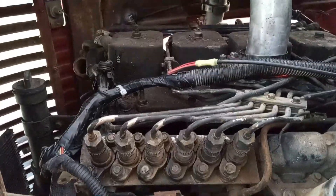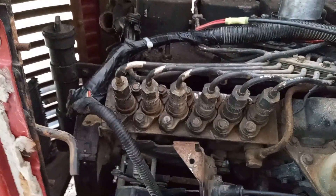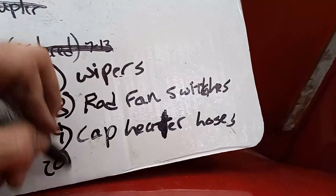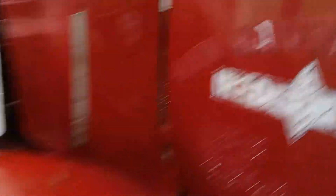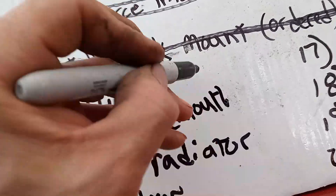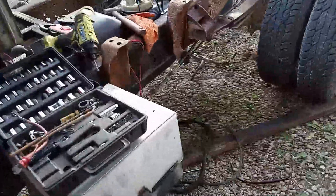I'm going to have one switch on the dash and then a thermostat-controlled one. I'm not sure where I'm going to place the thermostat — I don't like having them on the engine, because when you shut it off the engine heat can keep the fan going even though the water's not circulating anymore. I'd rather have it closer to the radiator, but I'm not sure where I'd even tap in. Another thing is the heater hose — I need to cap the heater hoses. He's also got seat covers to put on it. So right there's twelve items still to do, and I'm sure I'm forgetting something. End cap wiring is going to entail a lot of cleaning up in there too, and brake lights will include mounting the taillights.